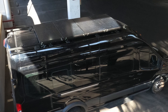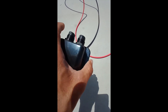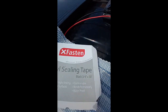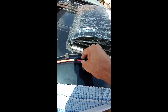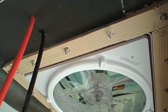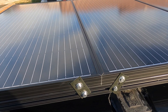Now we just need to get the wires into the van. We're running the solar cables from the roof through the little nuts in the holes we drilled in the top of the van. We seal everything up with butyl tape — putting it in the freezer makes it easier to work with, and using wax paper helps push it into place without it sticking to your fingers. Tightening the nuts squeezes the plastic and rubber together for a watertight seal. The solar wires come into the van through the double cable entry gland, and we sealed that with flex paste too.